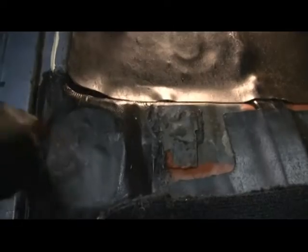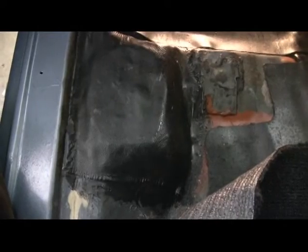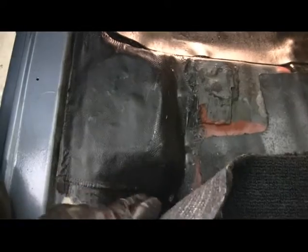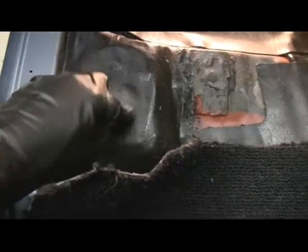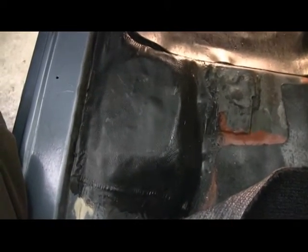Here is the location of where those body mounts are — it's under here. I don't know how many times I can tell everybody: don't cut corners. It's just going to come back and bite you. That's what I did here. I knew it was rusty when I put this car together 17 years ago. This is a big fiberglass patch panel. The body mounts were okay, but I knew it was rusty where it was attached, and now I am paying the price. The idea is to cut a hole in this — I think I can just peel back the carpet so I don't have to take the belts and everything out — so that I get access to that cage nut.